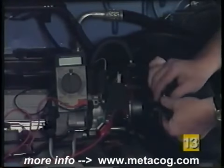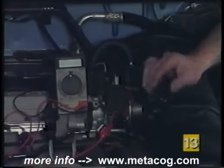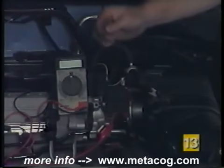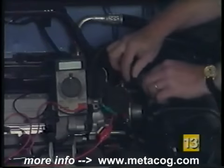to a battery. And by the way, the battery we have it connected to is the car's battery. We're using the 12-volt adapter here because this is a 12-volt device. Sure. Now, the green lead will be connected to the tach lead because we want to measure those pulses, and it also powers the whole tester up. See, our light just came on when I made that connection.